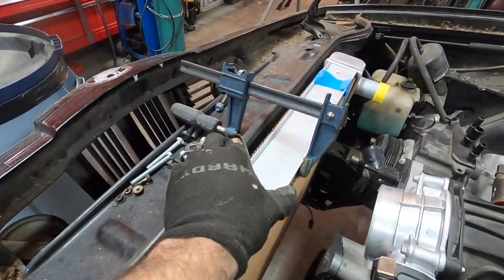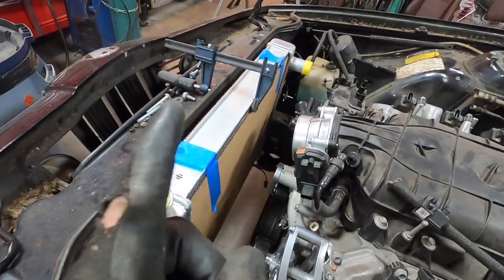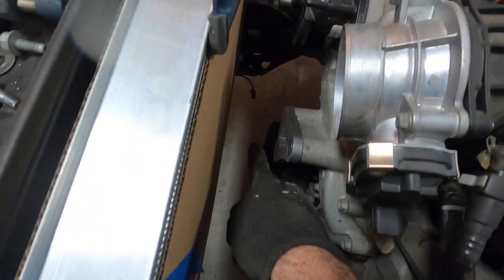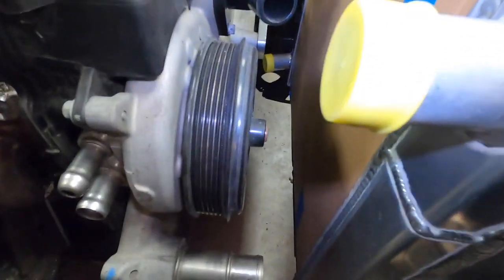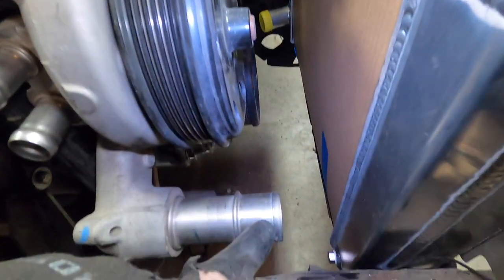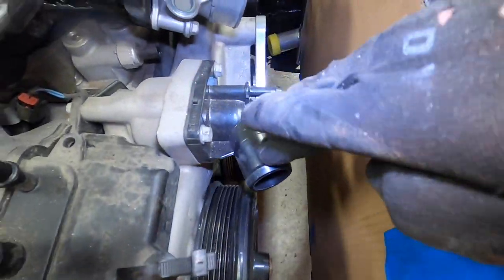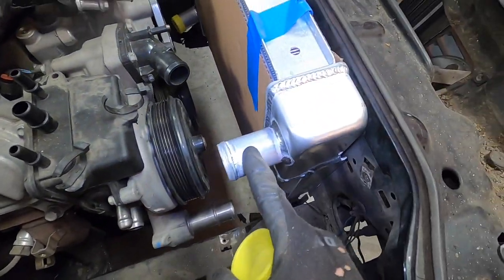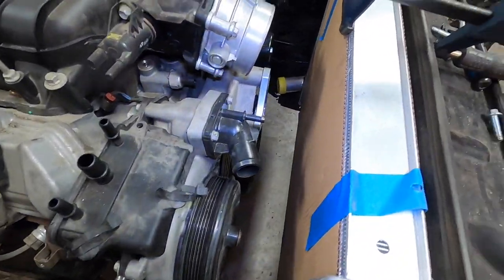It looks like it's pretty pinned up against here. I don't like the air gap that's gonna allow air to escape without going through the radiator — that's no good. The lower outlet has a lot of room; it's gonna curl around and keep it underneath, coming right down to there. Here's another view — it's gonna come all the way down below and connect right here. The upper is going to go from here right into the thermostat output directly — so that's actually a pretty easy run. I might have to cut this and weld an elbow to make it a little bit easier to route, with maybe a quick rubber hose there. The lower will be a little bit more complex.